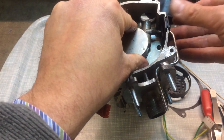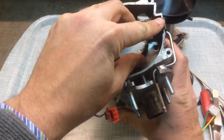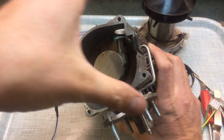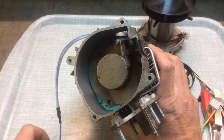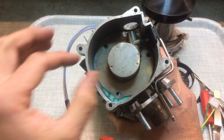If it doesn't — and it's quite easy to get it in the wrong place — then you could get an air gap and all of the exhaust fumes, if this gasket failed, would go straight into the van. If you think about the way this works, the air is blowing across this heat exchanger. So if you get exhaust gases out of this hole or this hole, then it will go straight into the outlet inside the van. So very important.